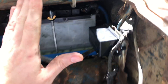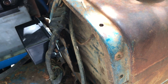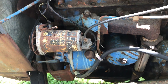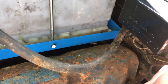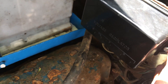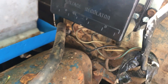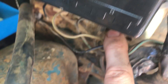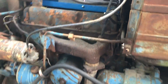A few days later I've got a new voltage regulator from Amazon — it was $17, super cheap. I went ahead and polarized the generator again; I didn't film that since I just showed the same process. To get the regulator out you've just got a little bolt here and two over here, then your plugs. If you don't have the original plastic plug, make sure you keep track of what's what. Down here you've just got two battery wires — you can actually reverse these, it doesn't matter, since this post converges together. Let's crank it up.